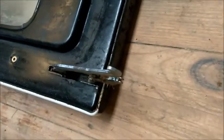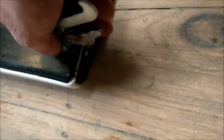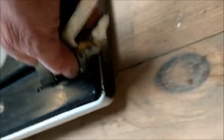Using a Phillips screwdriver, undo the top two screws and these ones here. Excuse the dirty oven door — it's disgusting, I know. There's a Phillips screw there and those are the two inner ones; we'll leave the outer ones for now. Now we are going to separate the door — the inner from the outer.